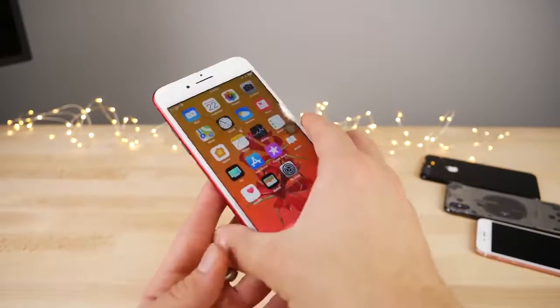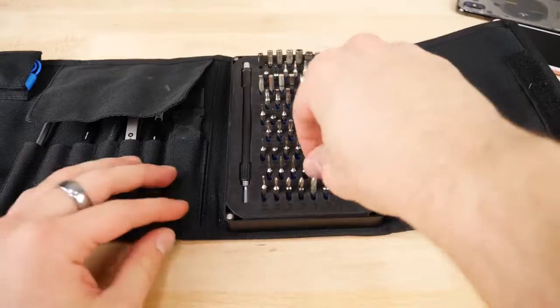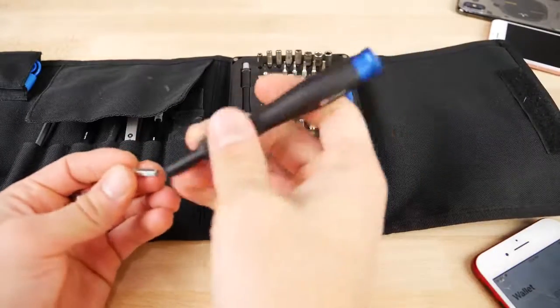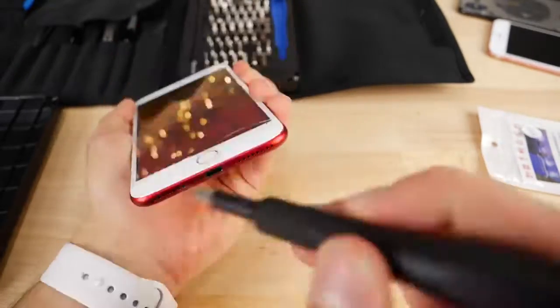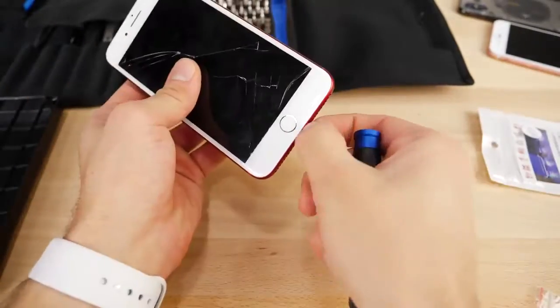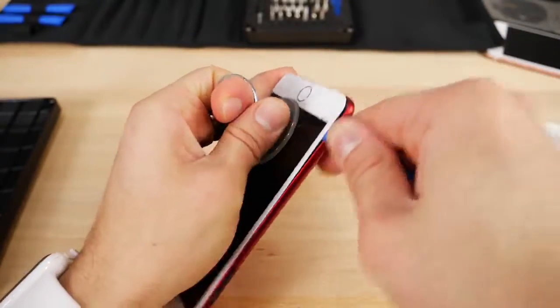But let's go ahead and take it apart. All right, proper tools make this much easier. So we're gonna take the pentalobe screws and remove the bottom. Oh, and of course, do turn your phone off before attempting this. That is priority here. Using this little pry tool, we're gonna pry the screen up, separate it, and remove it